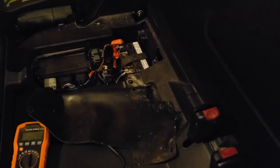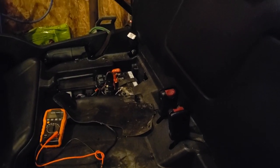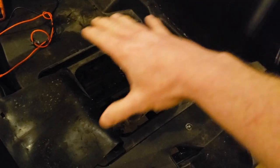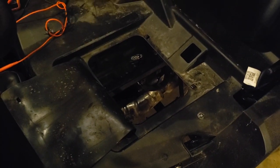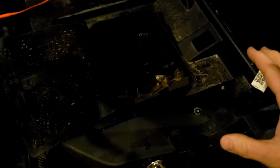I've added a ton of upgrades — a heater, a bunch of lighting, horn, turn signals, all that stuff. I just got done installing a winch, which is also going to be another big power draw. The problem with the stock battery is it's located under the seat and there's no more room there to add a larger battery. Some people use a battery isolator and add a secondary battery, but I want to get rid of the stock battery entirely.